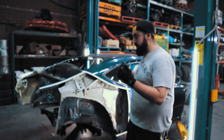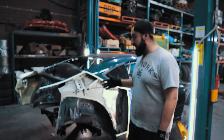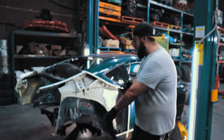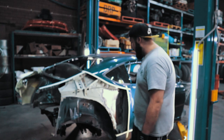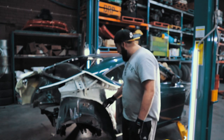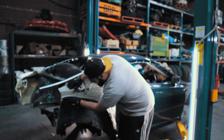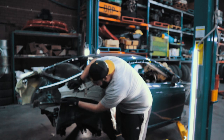Alright guys, got the other side cut off and I'm actually wrapped with how it's come out. I thought it was going to be a lot harder to cut out, especially here where there was the spot welds to separate the two panels. So what I'm going to do now is just clean up the panels. I did cut into here a little bit where it joins up, where I shouldn't have, so I'll clean that up